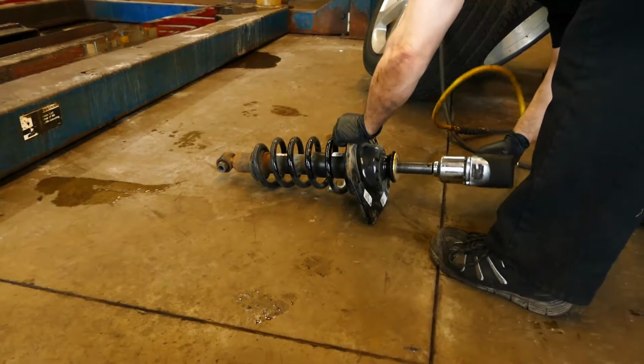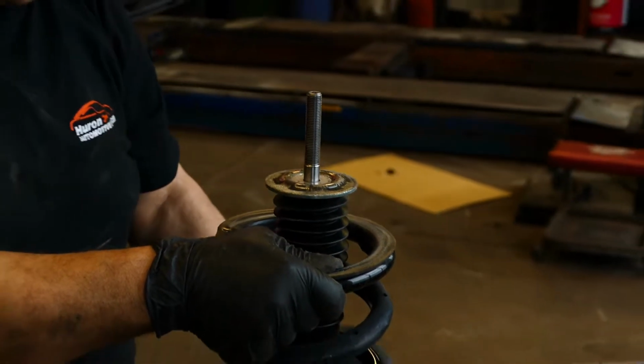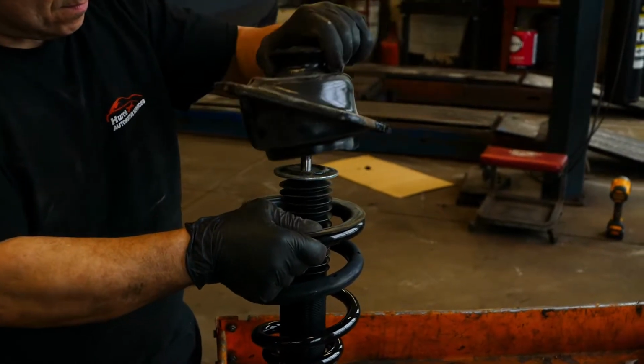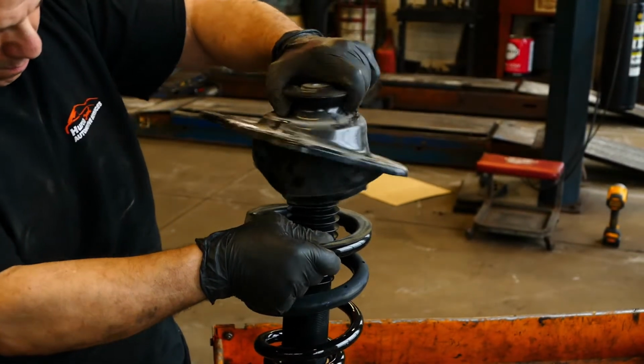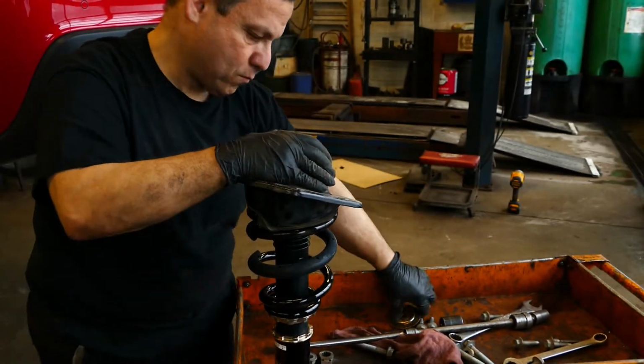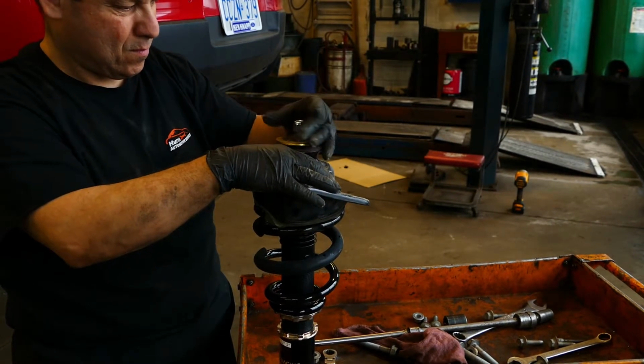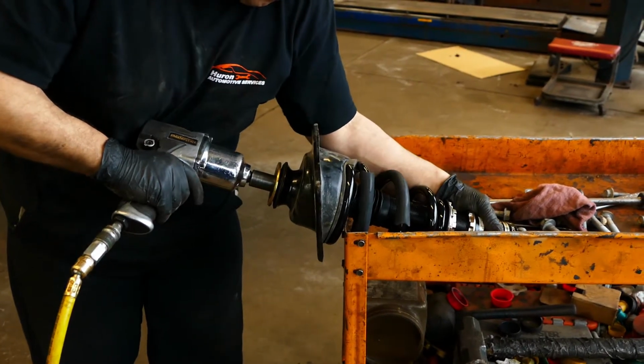The camber plates allow a maximum of 3 degrees camber adjustment, in addition to the amount of natural camber gained by lowering your vehicle. Front camber plates are available on specific kits, as well as rear camber plates on certain applications. Please contact our customer support team to discuss whether camber plates are applicable to your year, make, and model.